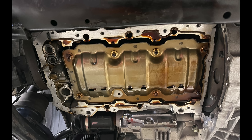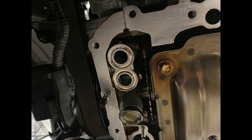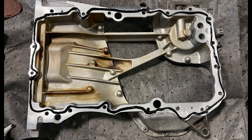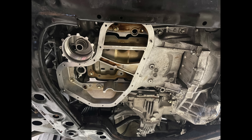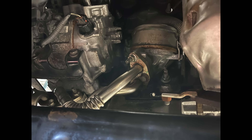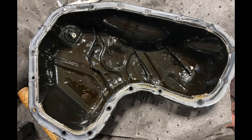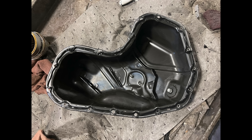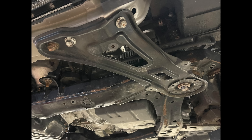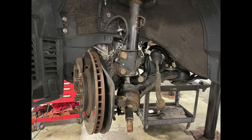Let's start cleaning to install the sub pan. Here are the two O-rings that go to the oil filter — those go in with some sealer. Here's the sub pan back installed and torqued. Now let's install the oil cooler line — it's a giant fight every time, but here it is done. Then install the oil pickup tube, clean the oil pan, apply sealer, and install it back along with the oil filter. Now I put the four little support brackets for the subframe back in, then install the exhaust.